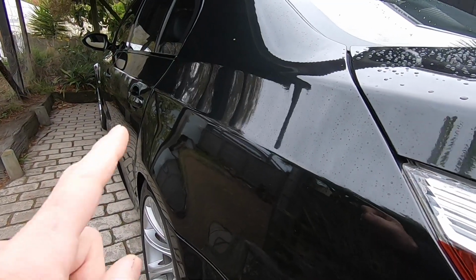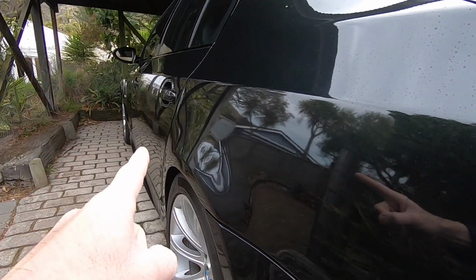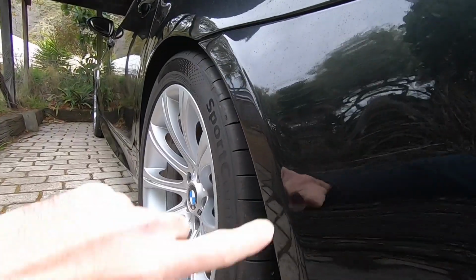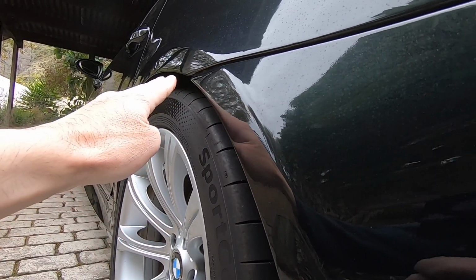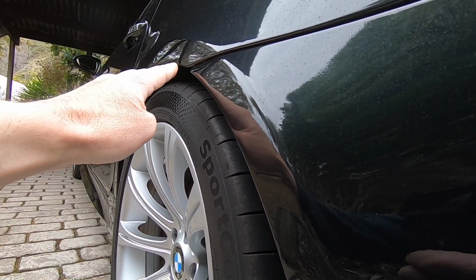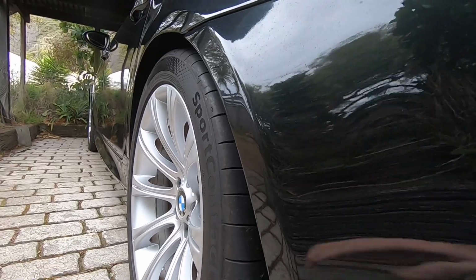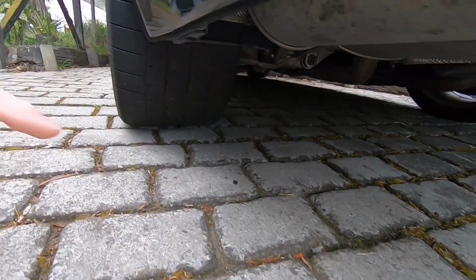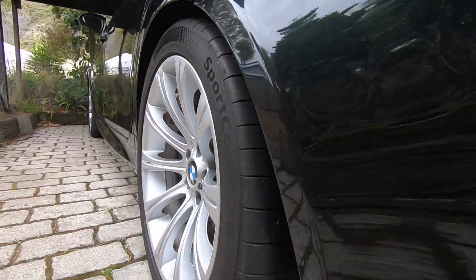And with the rear wing here, the rear fender, that wheel arch lip there is exactly the same as a regular E60. It doesn't bulge out like the front one does down at the front there. Now the only difference being, the plastic inner wheel well liner is actually trimmed back here. So the original ones on the E60, the wheel liner comes right to the edge there. This one's trimmed back, so it's actually fitted just a few inches further back, and that's just to accommodate for them larger wheels. And then the wheels are much wider than a regular E60, but the depth goes that way towards the inner side of the car. So although the wheels are bigger, that wheel well's just trimmed on the inside there.